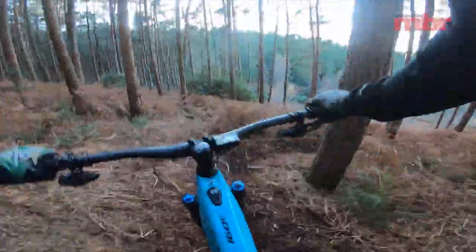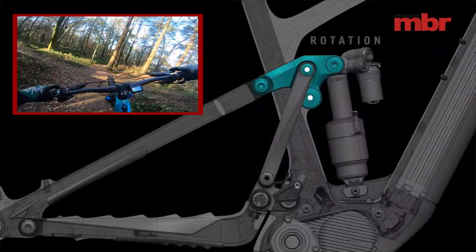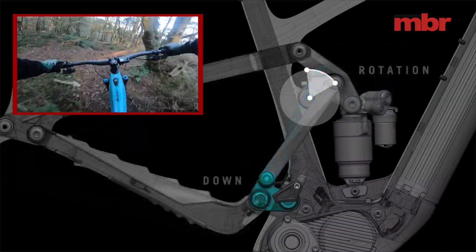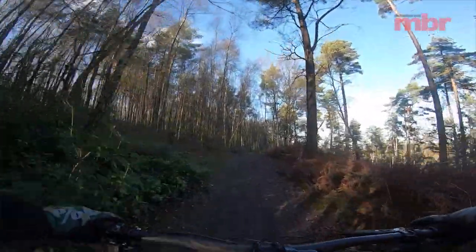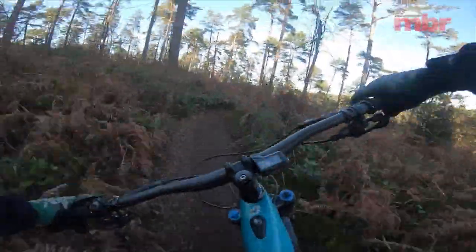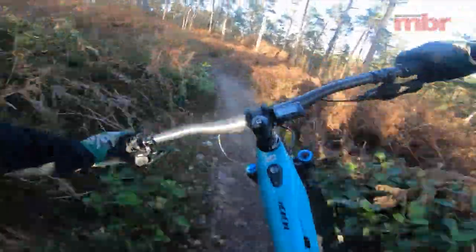So let's talk about this Sixfinity suspension. It's a complex linkage for sure, but it basically aims to do a similar job to Yeti's Switch Infinity design found on analogue bikes like the SB150. During the early part of the travel, the lower link rotates upwards until about halfway, when the Sixfinity strut starts pushing it down again. This changes the virtual pivot point and the direction of its migration, which affects the anti-squat characteristics. So Yeti can keep anti-squat consistently high through the sag zone for pedal efficiency, and then once past the inflection point it can fall away to give good bump compliance, support, and less pedal feedback.